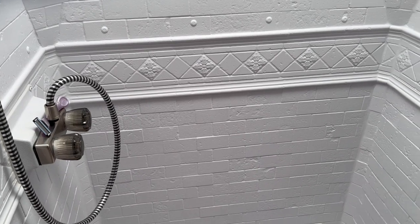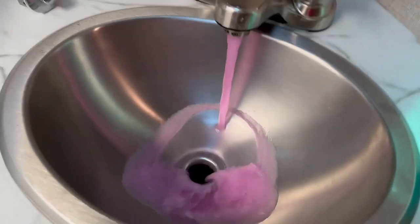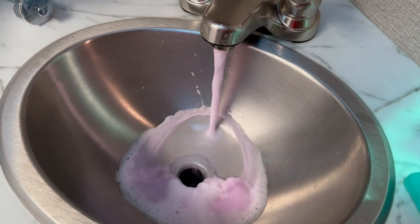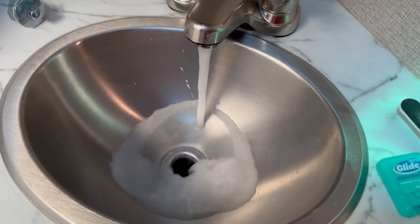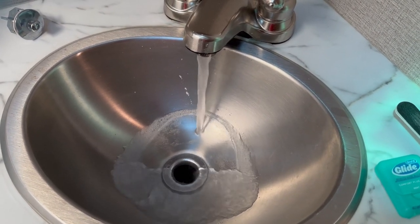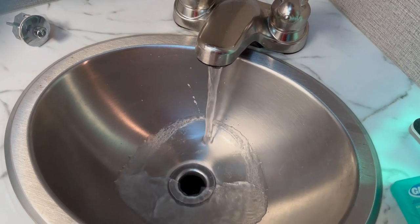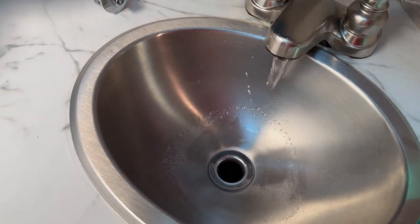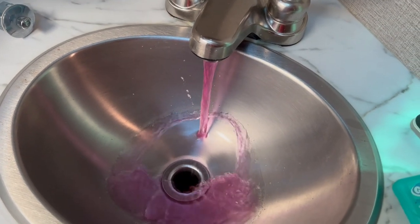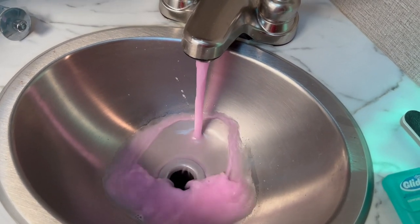We want to make sure that all of our sinks, any sink in your RV, any shower, anything producing water has to be flushed out. I'm also going to take the cellophane off my toilet and run that a few flushes so those lines are sanitized too. Let's turn on the cold side first — you can see it's all pink and we'll have some air in the lines. Run it until it's clear, then turn off the cold and turn on the hot water side. I usually let it run about 30 to 45 seconds each side.